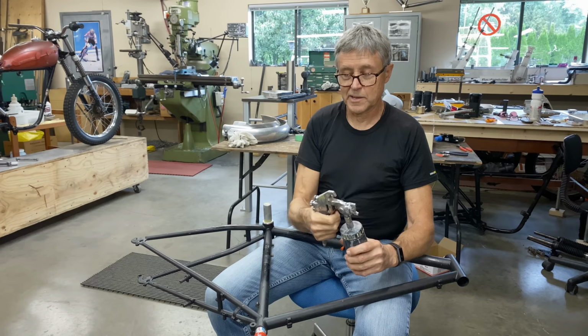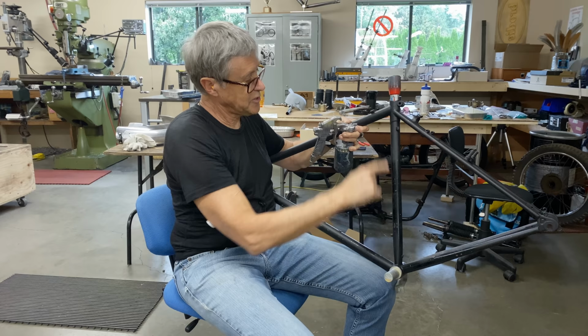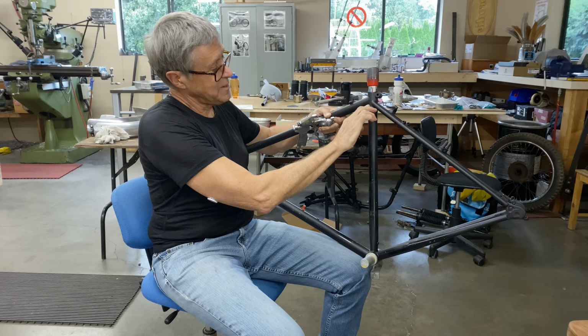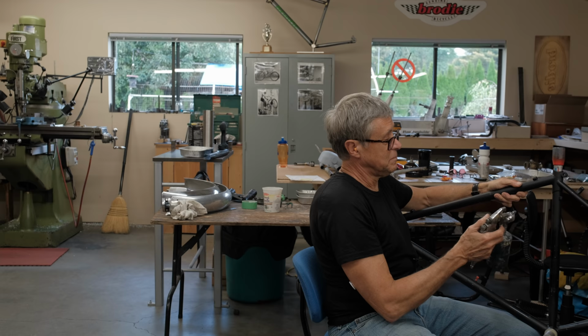It's not easy spray painting a bicycle frame. I'm told it's a lot easier to learn how to spray paint a car. Because what happens is, when you spray, you have to start and stop. And you want to stop at exactly the right spot. You don't want to go up farther, or overlap, because when you spray this tube here, you want to go to the corner so that it meets. If you're going over a bit and over a bit, you're going to get a run or a heavy spot. It's really crucial that you get the right amount of paint and that you're really accurate and you don't go over the same spot more than you want to.